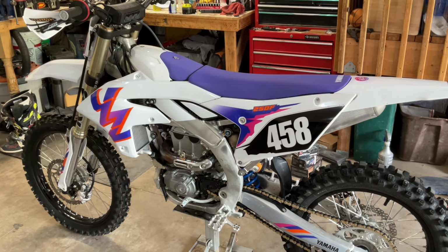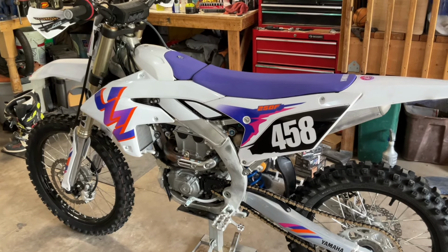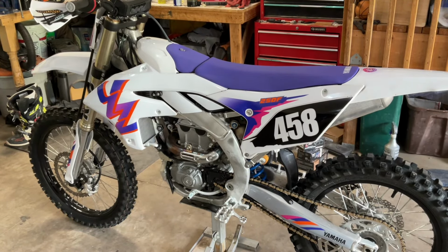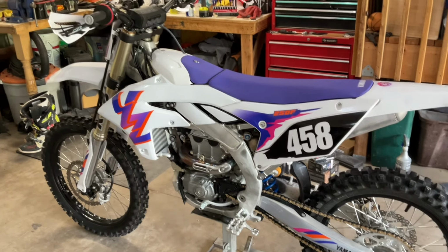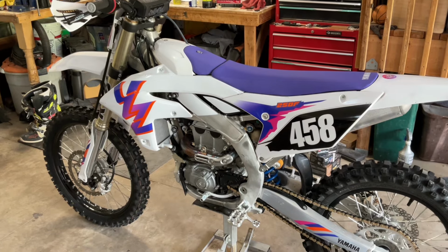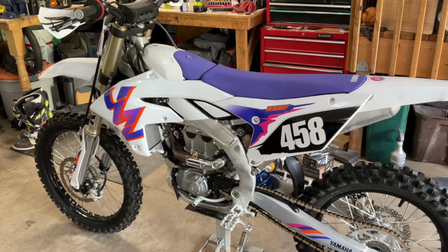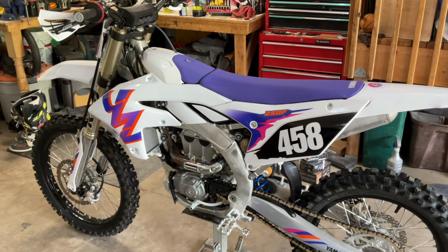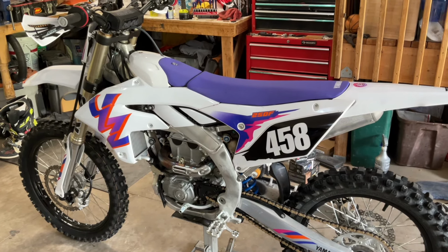Hello everybody, I wanted to do a quick video, well hopefully quick video on the YZ250F, the 2024-2025 model. I had a 2019 before this. Tons of low end power, really love that low end power. Trying to get some of that back on this bike. So I've got the YZ450F airbox and the Williams Motowerx adapter. I'm going to see if that smaller airbox from the 450 is going to help out, see if it's going to give me back some of that low end power.